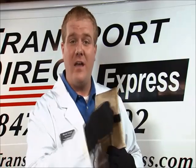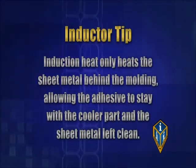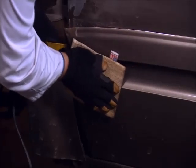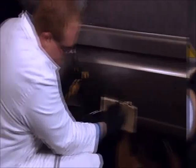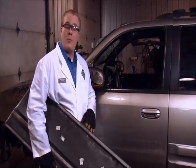The Fast Off Pad has a reversible strap for adjustment and either side can be used for even wear. With body side molding removal, traditional methods leave torn foam and adhesive behind in the metal. Induction heat only heats the sheet metal behind the molding, allowing the adhesive to stay with the cooler part and the sheet metal left clean. Apply heat to the metal at the end of the molding. After a few seconds, apply outward pressure to the molding. Watch the adhesive release from above to determine the speed of movement. Keep the pad in motion so that you don't overheat one spot. Most of the adhesive and all of the foam backing came off with the molding.